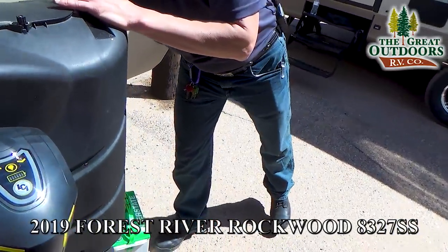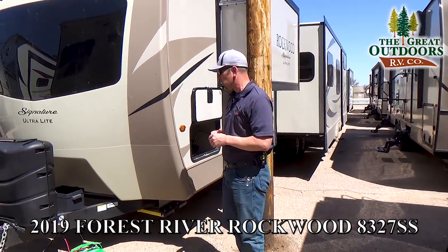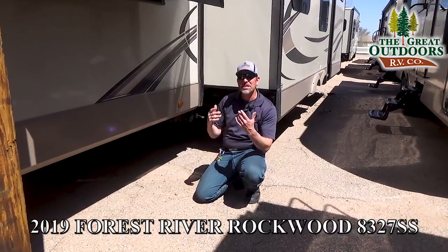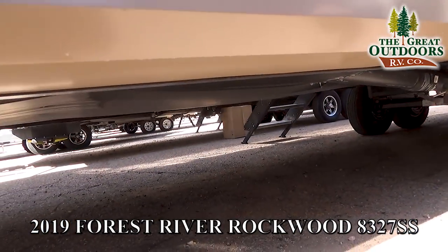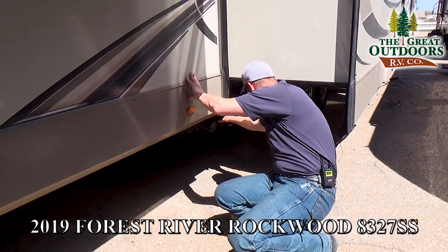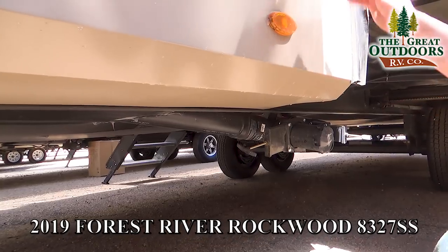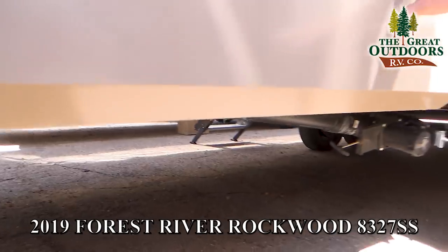You also have a battery disconnect in the back. That's pretty cool because that's the only way you can 100% turn off all of the power to your coach — you can either disconnect from the terminals or use the battery disconnect. One of the things I also do with all my Rockwood Signatures: I enclose the underbelly and I also put 12-volt heating pads on all tanks to include your dump valves. That's important because you don't want any residual fluids in here freezing up on you. As you can see, that's the gray and black dumps right here, and as you notice — the enclosure of the underbelly. Keeps you nice and warm.